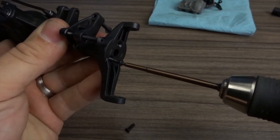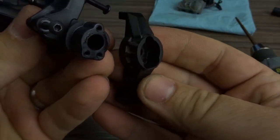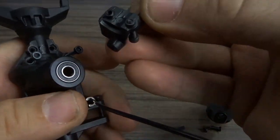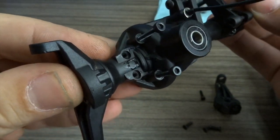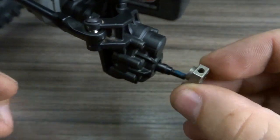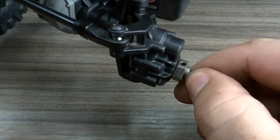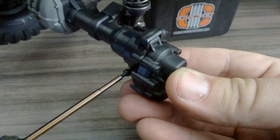The C hubs on these axles are held on with three countersunk screws. Remove those screws and the C hub pulls off nicely. This is a non-adjustable caster axle. Removing the lower link mounts is simply two screws and that unit pulls off — the other side is the exact same even though the panhard mount is incorporated into it. One thing to note is when you are reinstalling this, make sure that the shoulder on that 12 millimeter hex goes in towards the portal box. It can go on the other way and you can tighten the set pin, but you will get a lot of rubbing and that will definitely tear up that portal box — so make sure that you install it properly.